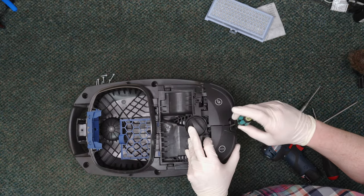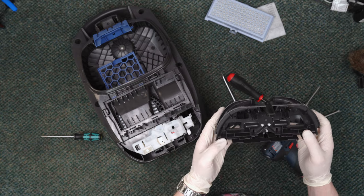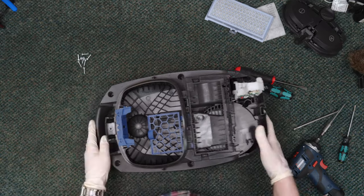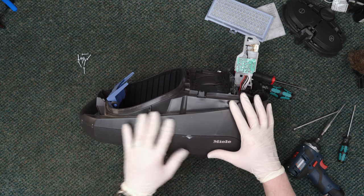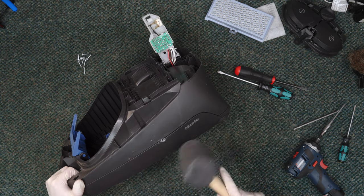There's a clip right here and that will come out. Now these two pieces need to be separated and they're not easy — there are a bunch of little claws that come down together and fit together to give it more structure, but they make it kind of a pain to get apart. You do need to give it a little tap. I hate doing this, but you can see the gap starting.